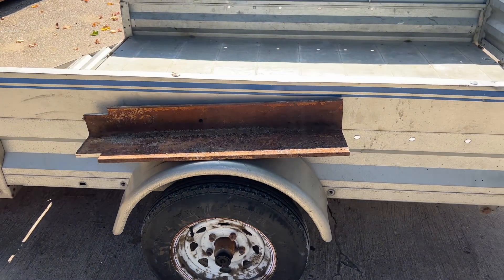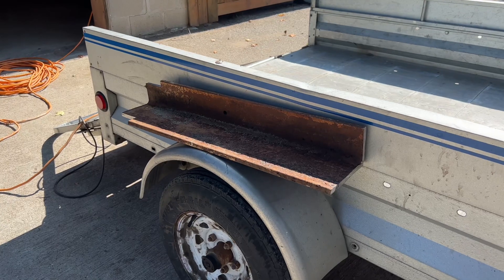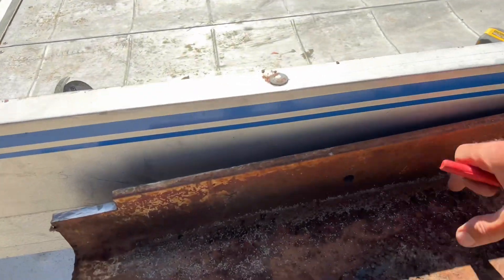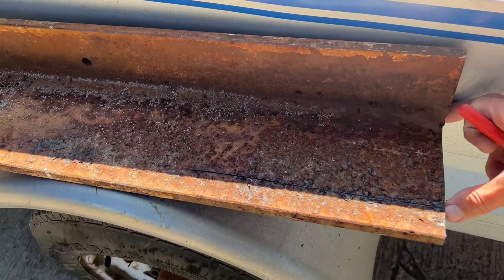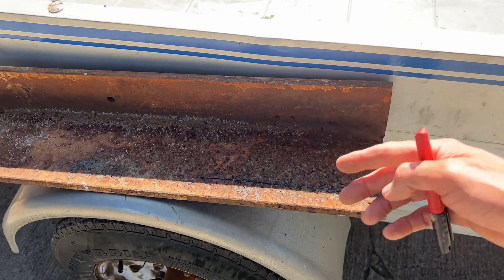That way you're not carrying the winch around with you, but you've got this hidden piece of angle in behind. As I move along, I'll take video of the installation. Right now I'm just trying to cut this depth down — I need a maximum of about five and a half inches measured between there and there, or else it's going to hit the bumper. The bumper is actually going to sit somewhere right around here.